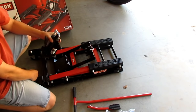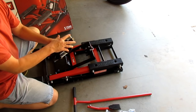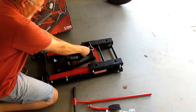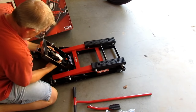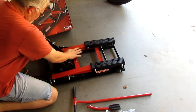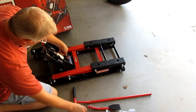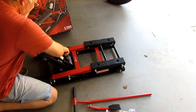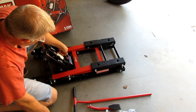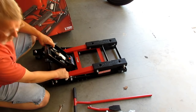To put it together, make sure the foot pedals are on the side of the jack away from the pads. Slip the rod in the top of the bottle jack into the bracket, put the thumb screw back in all the way, flip it up, then turn it around to get the holes on the bottom of the bottle jack lined up with the holes in the base. The bolts are already threaded in — no bag of loose bolts. Takes a 14 millimeter wrench, though a ratchet and socket would be easier.